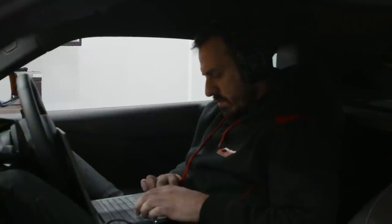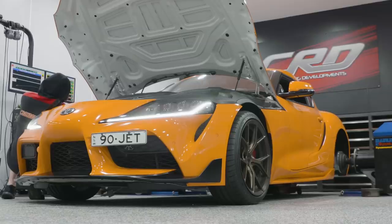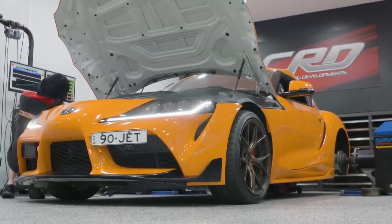Con did say the car could potentially make more power if we really wanted to squeeze it. But we've decided to leave it where it is with that extra 90 horsepower, based on results we've seen elsewhere and the fact that it's doing it really easily. We haven't had to lean the car out too much at all to make that grunt. We don't know how much back pressure is in the factory exhaust, so we're not going to try and make any more power until we've done the aftermarket downpipe, which we've already got from Golby's Parts in Queensland. The next step after we drive and test it down the quarter mile is to go downpipe, tune it again, and then try a few more small mods to harness the most out of the standard turbo.